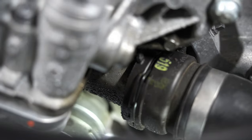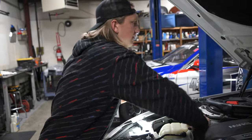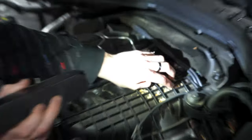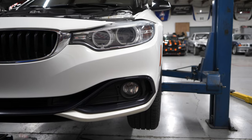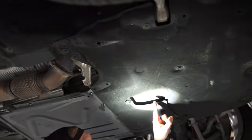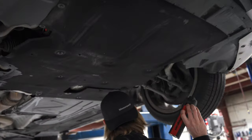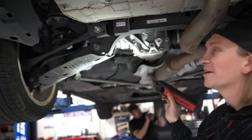We also have a crank guard to help avoid that issue. The valve cover gasket looks surprisingly clean. No more evidence of the oil filter housing gasket leak right up under there. Coolant looking right. I guess this thing was parked under a tree for part of its life. We definitely have some oil leakiness — I can see a nice little amount producing from right there. The oil pan gasket looks like the culprit from what I can see.